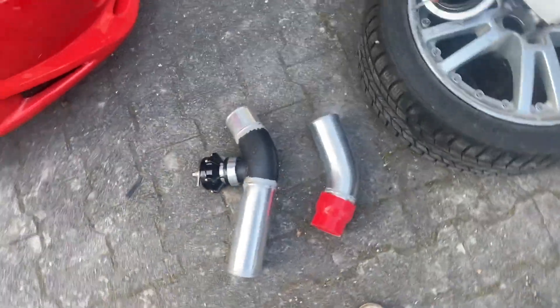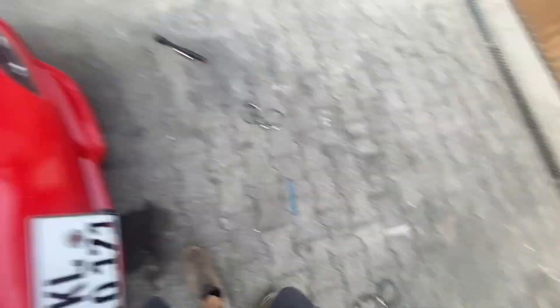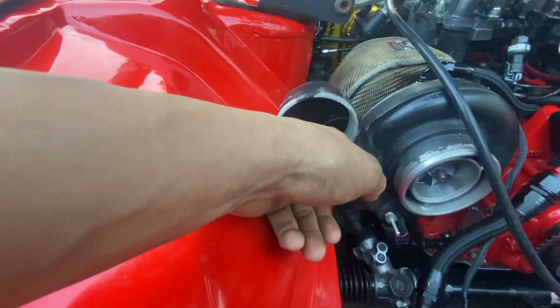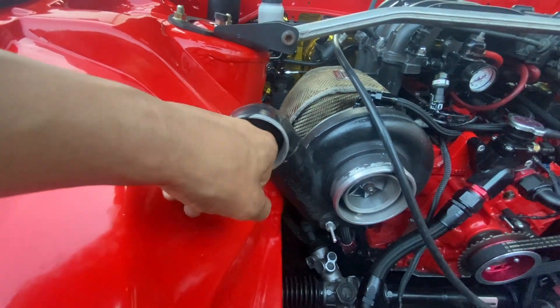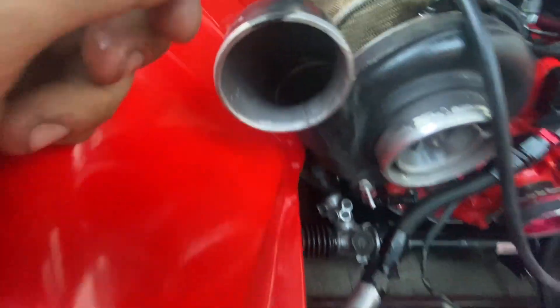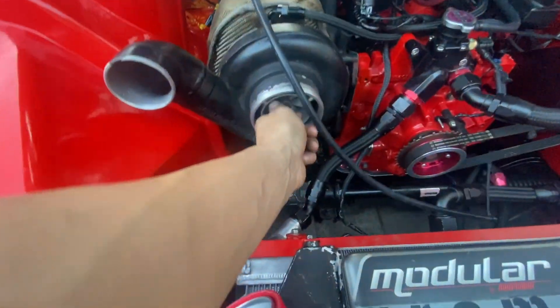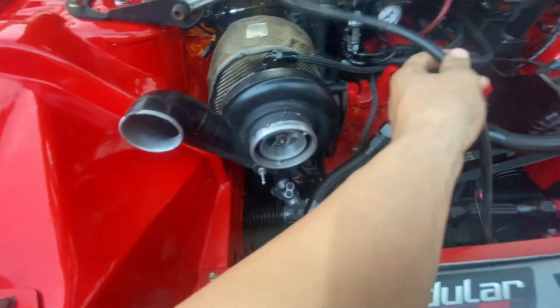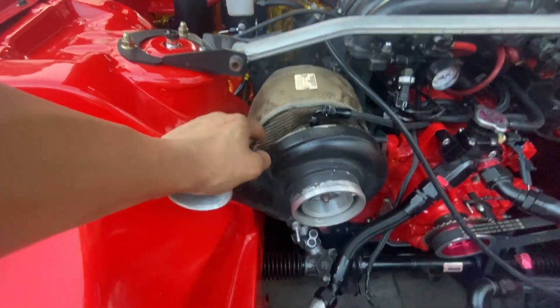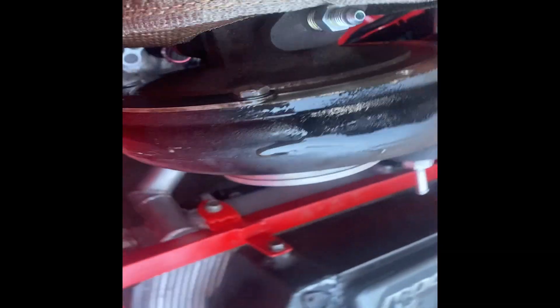The intercooler piping is off, which needed to be painted anyway. I looked inside and we have a bunch of oil on this little lip — you can see it, it's kind of hard to tell. This thing definitely — hopefully it could be rebuilt. I don't know too much about rebuilding turbos, but I'll take it to a shop and they said they think they could rebuild it. I just clocked the turbo and look at all this oil on the bottom coming out.